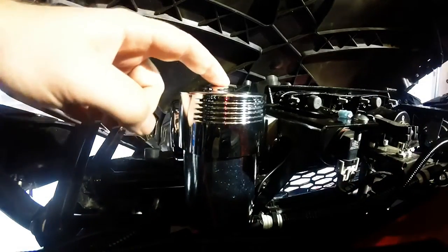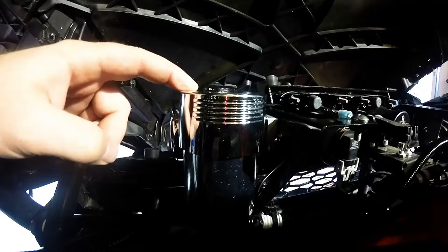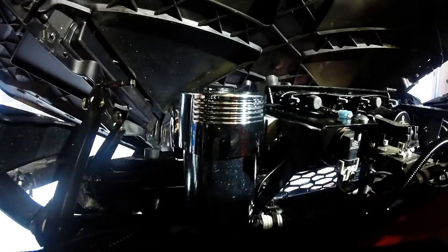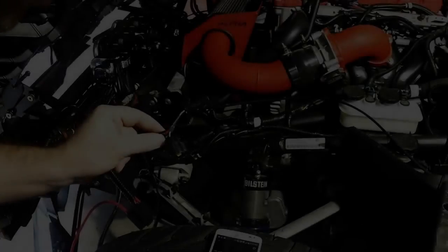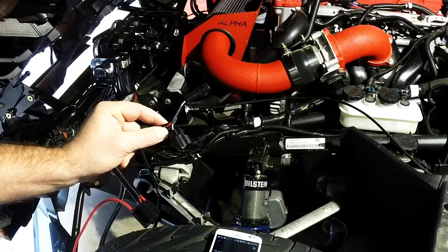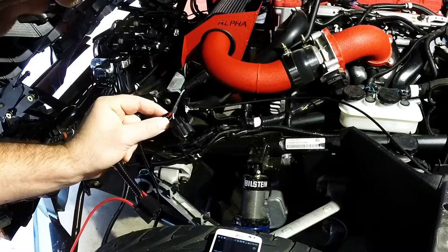Be sure to mount the horn straight up and down as shown here. The horn isn't designed to operate in any other orientation, and if you do, you could cause damage to the bearings inside the compressor. At this point, you'll be looking at three main connectors left on the wiring harness — two of them paired together and one larger one attached to the battery wire.